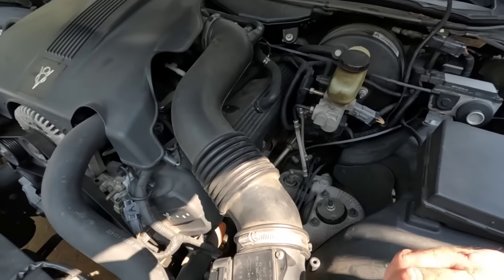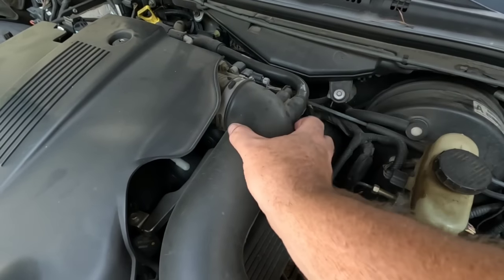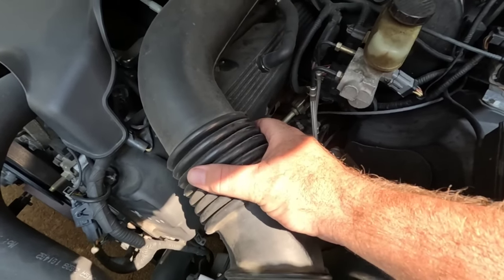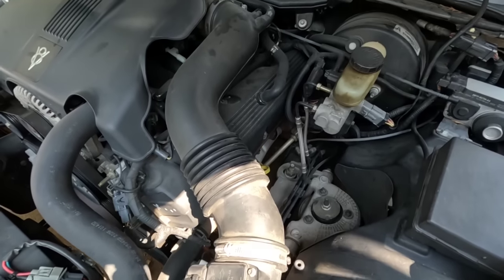When you do this mod, don't expect a ton of power. On the guessing side of things, I'm going to guess probably three to five horsepower tops. When you see these ads of cold air kits adding up to 20 horsepower, it's not true, folks. It might be true with the hood open and with air blowing on the filter in a perfect world with dry ice on it. When I do the calculations at the end of the video, you'll get a better picture. One thing I'll mention is maybe down the road upgrading this tube, because this 90 degree elbow is a restriction, and this corrugation causes disruption of airflow. But that's still pretty good bang for the buck for 10 minutes of work.